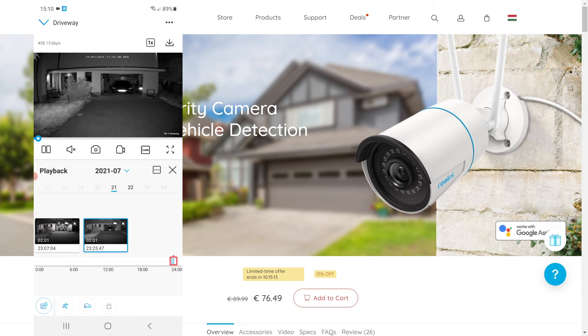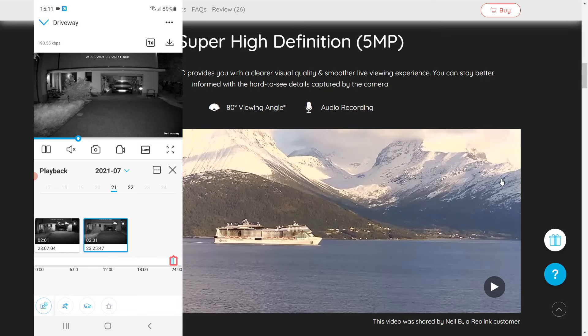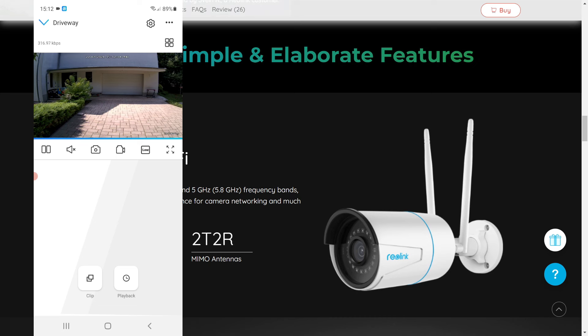Based on these limited examples, it does look like it's working. The reason I'm really happy about this is that by deselecting the general motion trigger, I can pretty much eliminate all false positives - it really has to detect a person or a car to show you something, so it will only show meaningful recordings. I set sensitivity to medium and haven't seen any cases where the camera failed to identify a person or vehicle. From about 10 meters approaching the camera it definitely sees you as a person.